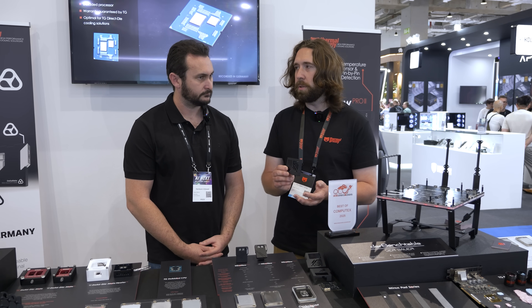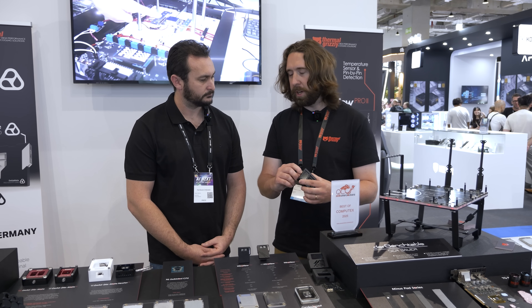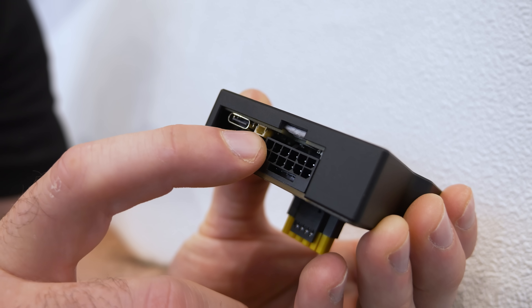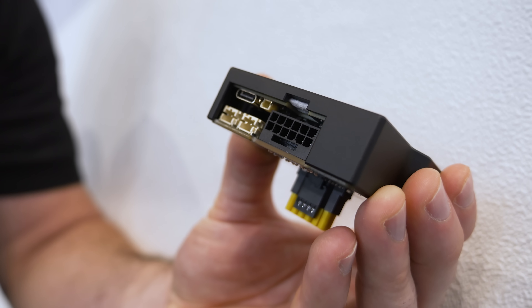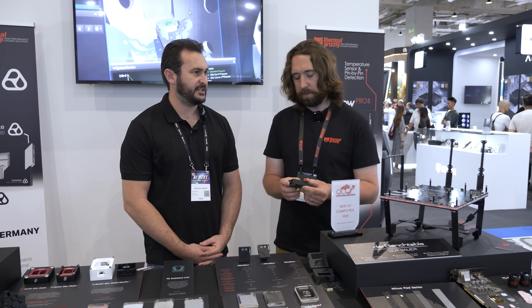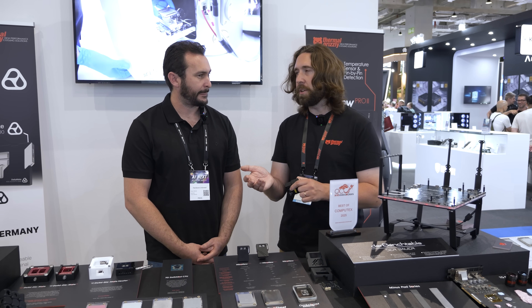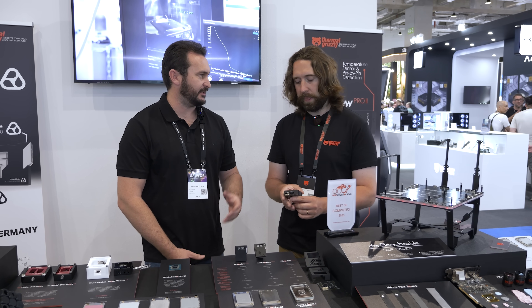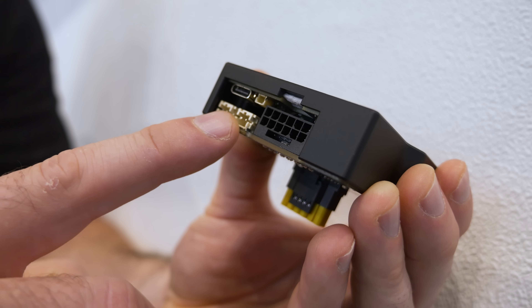There's USB-C, but it's not necessary to use it. Everything will function with just the power — you don't need any software, it will just work out of the box like the old Wireview. Another addition is a two-pin header that can have a wire splitter going between the power button on the case and the motherboard, so the Wireview can actually shut down the system if it detects an imbalance across those six lines. You can set tolerances for that — over-temperature, over-current, current imbalance, or just overall power draw. So if DaBao were to cut four of the wires, that would stop him from destroying the computer. Basically a DaBao-proof function.